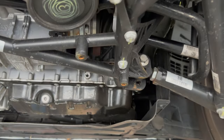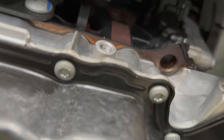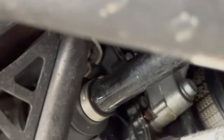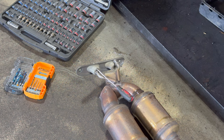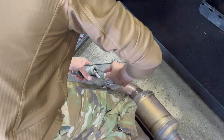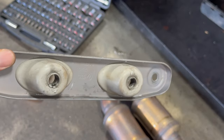It's a 13mm — about to pull it out. It's kind of a pain in the butt to find. There it is, right up in there — behind the axle. You'll need to get that off from the downpipe. I was told I'd have to drill these off, but with a flathead from behind and just a little leverage, those bad boys pop right out — didn't rip it, didn't damage it.